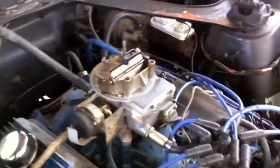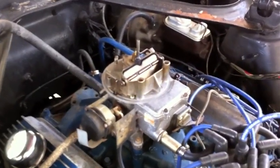We've got breather caps for both valve covers. We're sticking with the two-barrel carburetor right now and we're going to get a carburetor kit for it. We are going to plug the PCV and not use it on this car because it's really not necessary.